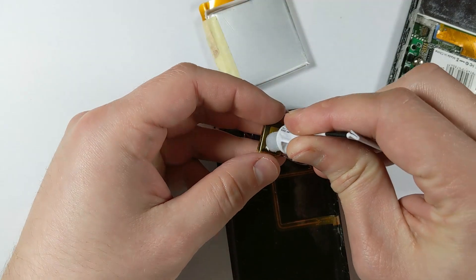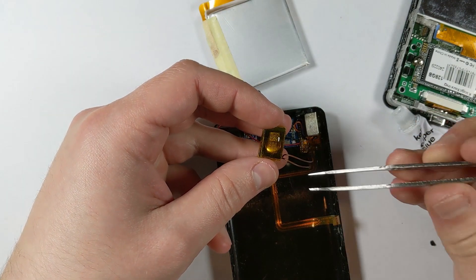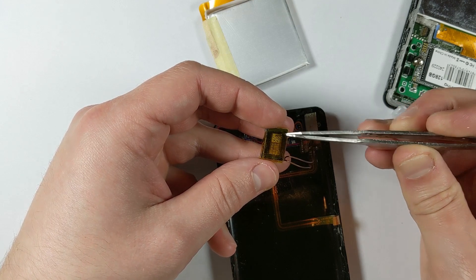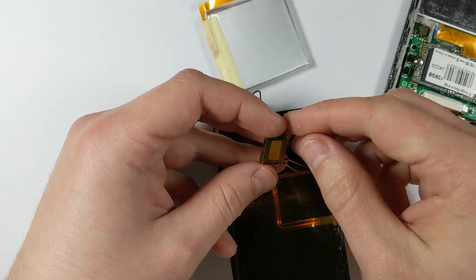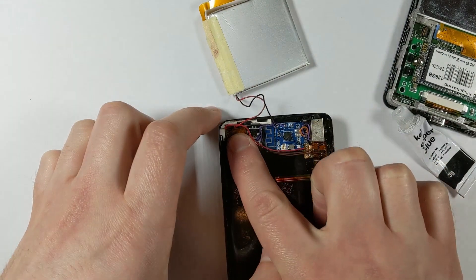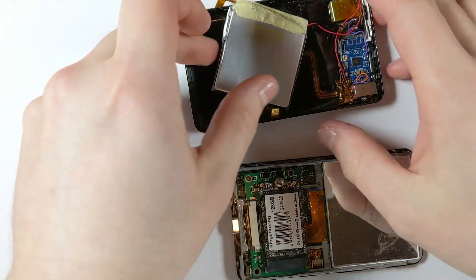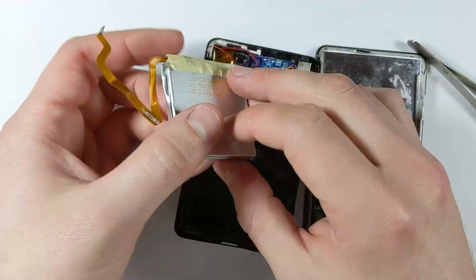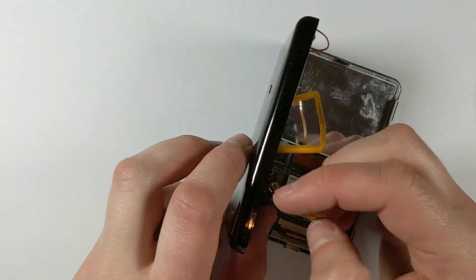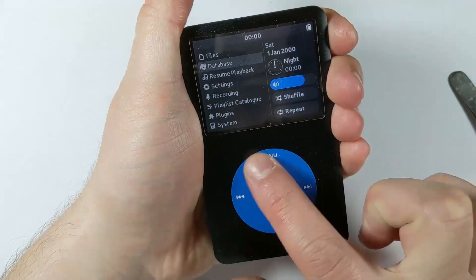Once you're satisfied that it's all working, now we can glue it into place. I'd recommend using a hard-drying superglue for the best effect, then pressing down on it with a bit of pressure till it fully dries. Now to just seal the iPod back up, making sure none of the wires get caught in between the frame and rear housing. I'd recommend checking out my iPod Classic 6/7th gen guide in order to get the rear housing back on so that it looks like it's never been opened. You can push the clips along the side rails back into place and push the sides in a bit too, just in case they're flexed out when prying it off.